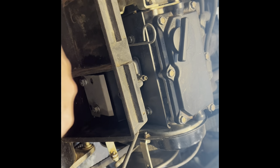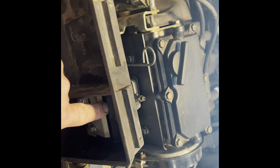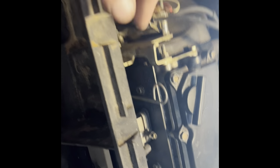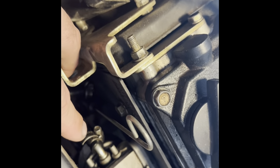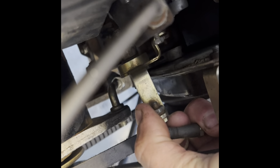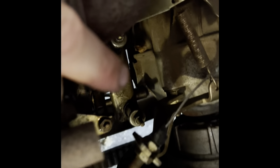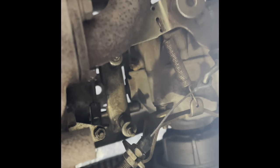I took the cover off the box, so you don't have to do it. You'll take these two nuts off, pull this off, then there'll be four bolts behind it — all threads. Pull those off, this cover comes off, your carburetor is here, you've got your inlet, a couple of drains, and then these linkages. The linkages just pop off nice and easy. You're going to have one little one here, this one, and then this one right here.